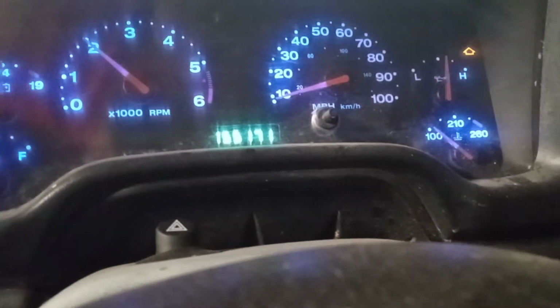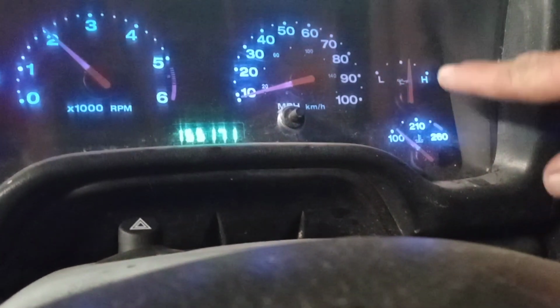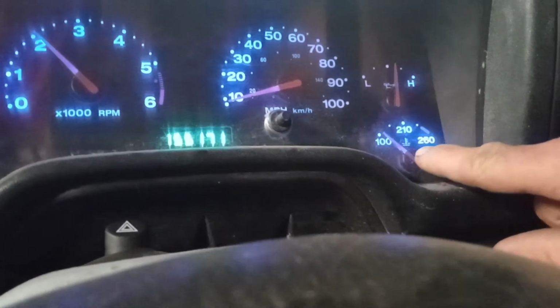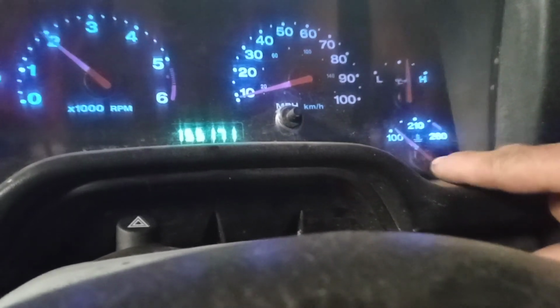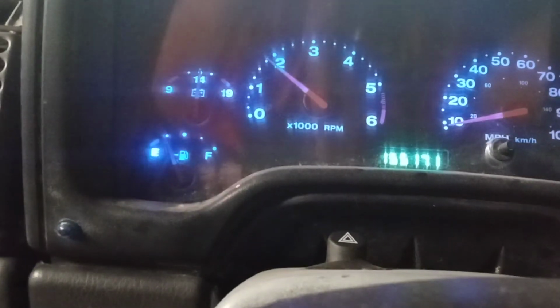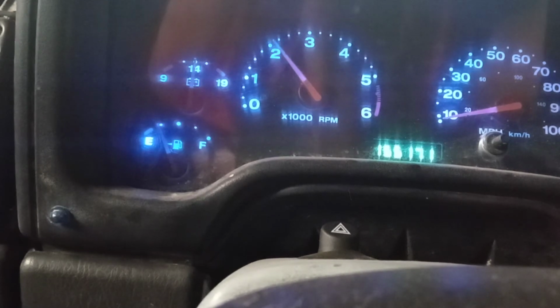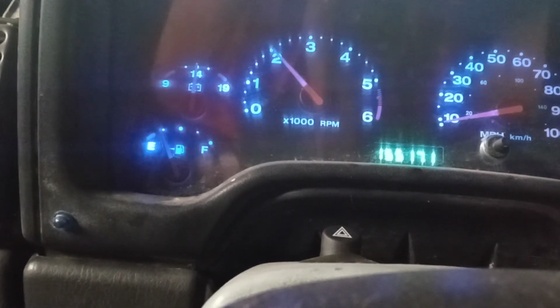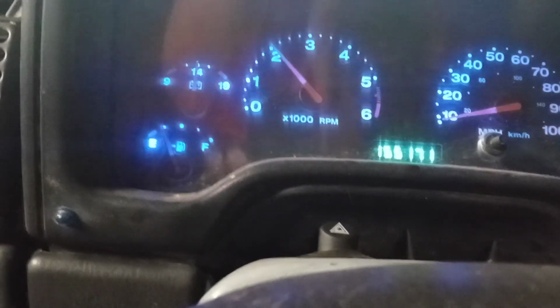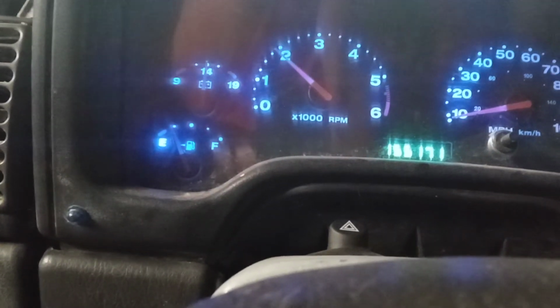But watch your gauges. Oil pressure is good. I like where it's at. Temperature, I'm not even going to run until it's hot enough to do that, but keep your RPMs there between 1800 and 2200. That's about 2200 there. You just move your foot slow. I'm doing it a little fast right now because I can't hold my foot steady enough. Whoa, tools are falling.